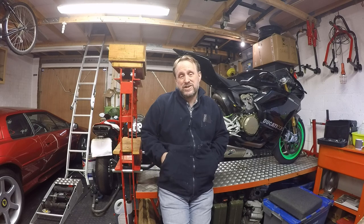They're in reasonable condition and I'd like to leave them that way — they're a nice set of '94 cases off a '94 bike, so I'm going to try as much as possible to keep it in original condition, unless on close inspection it looks bad, in which case I'll probably do something slightly different. We'll then go through and make a judgment call on the head conditions and cylinders and whether they need to be stripped back and cleaned. We'll look at the wear on everything so we can make decisions on whether to replate the cylinders, look at the rocker arms, see if any of the chrome is worn away.